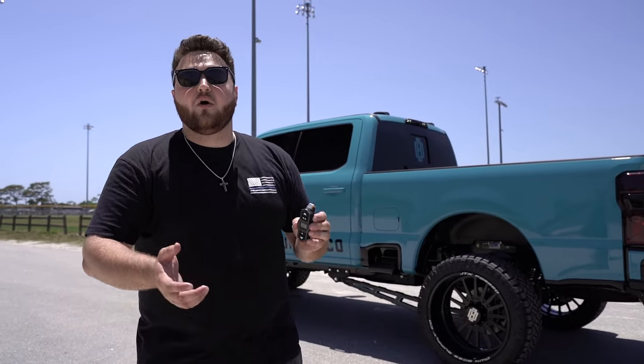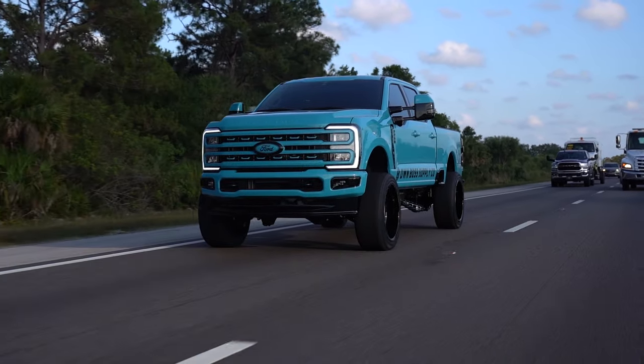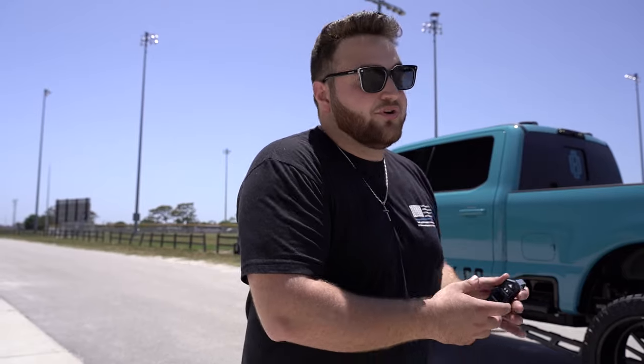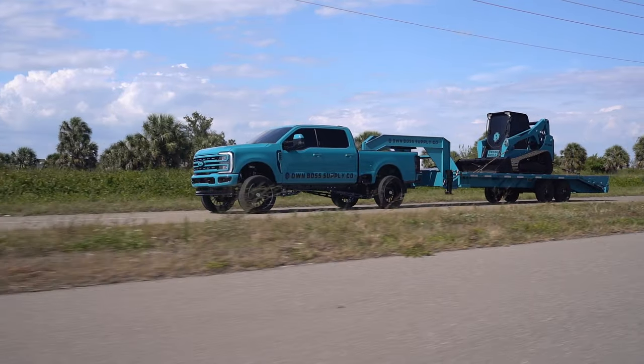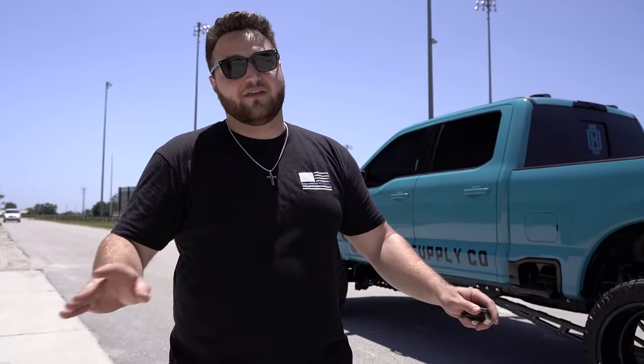Basically from the flip of your switch, when you're hauling and it's running a little too tight, you don't need all this pressure in the bags. You can load the pressure down when there's no load. When you're hauling and you have a huge load in the truck, you just click this button a few times and now your truck won't be sagging anymore because you have air pressure in the back holding your suspension, your axle, your leaf springs, and your load together. Very, very cool. The first mod you should do to your truck no matter what, if you haul any sort of thing.